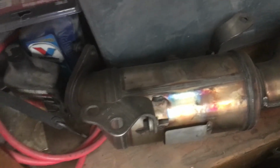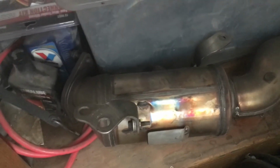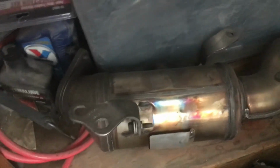This is a little bit too much for your engine. A lot of people blow engines because there's so much exhaust temperature and it melts the pistons. And the ring gap totally gets expanded to the point where it just starts chunking pistons. So the best chance at the dyno is putting an off-road catless downpipe on there. And you just use it for the dyno and track day at the racetrack. For regular street driving, either drive this, highly recommended, which is the factory, or this performance catted downpipe, which I removed just for dyno day.